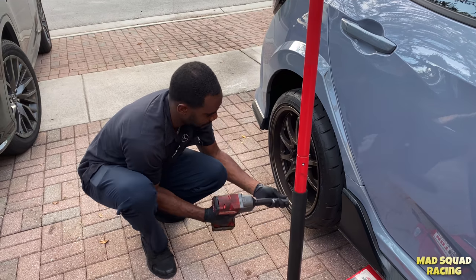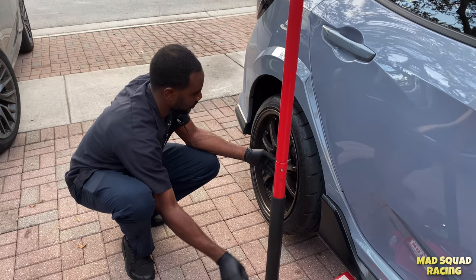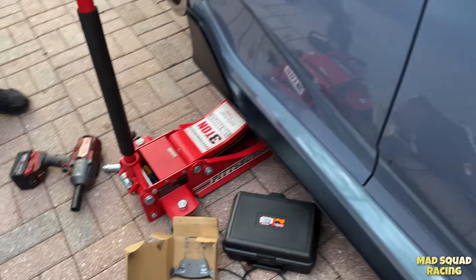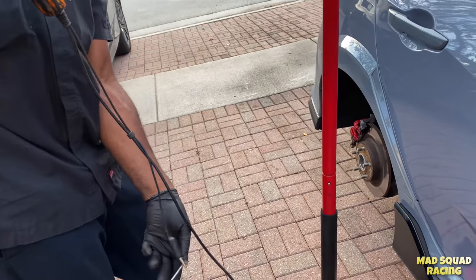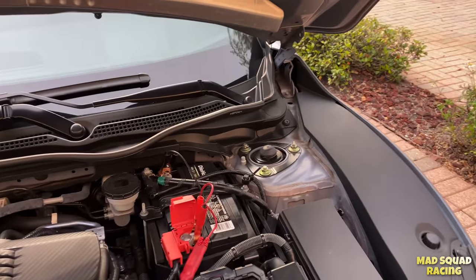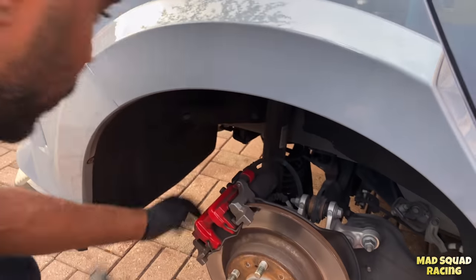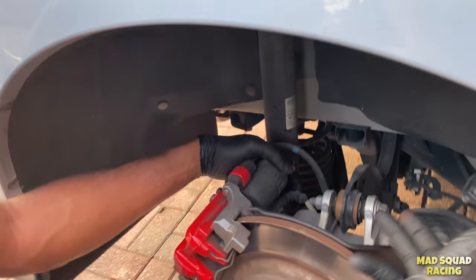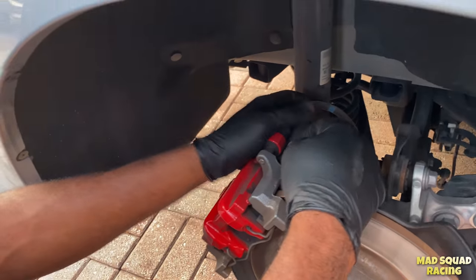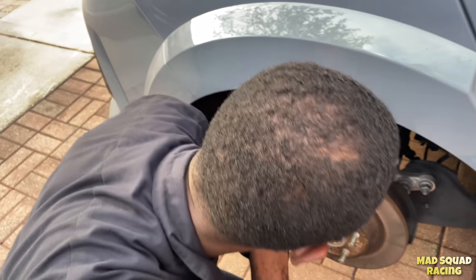I'm eager to learn so I don't have to call my buddy again — with these cars the rear brake pads wear faster than the front. We're using the Power Probe tool here. You connect the positive wire and ground, then unplug the power wire coming from the car. There's a motor on the brake caliper with a sensor for the emergency brake — we're going to send power to it to release the piston, then push it in.